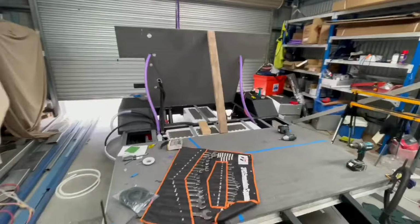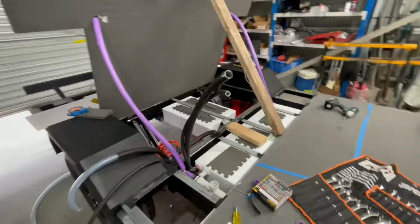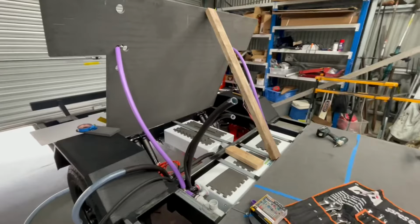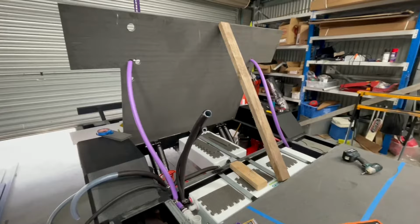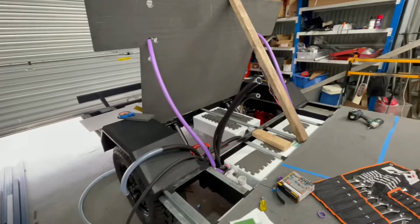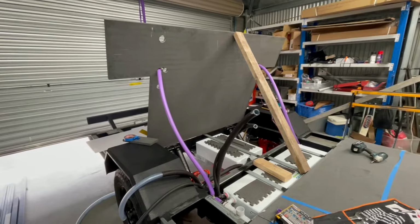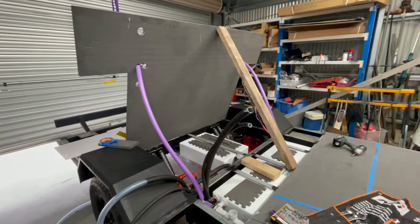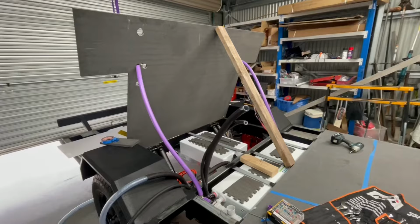Oh, it's a bit of work in getting all those pipes up and fitted off and heat shrinked and ready to roll. So just got the floor propped up, as you can see. I'm going to drop that down over the pipes, make sure it all fits snugly, and then bring the other floor sheet in. There's a couple of penetrations in it as well at the back, and drop that on and make sure everything fits neat and looks good. And then just level the floor up, get a straight edge on it, make sure I've got to put packers to get it all level, and then pick it all back up again slightly off the deck and chuck some glue in underneath.